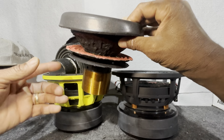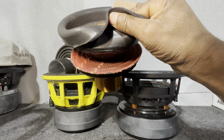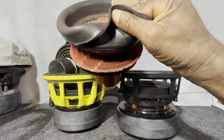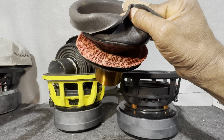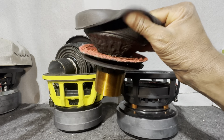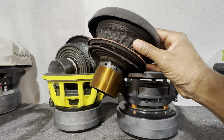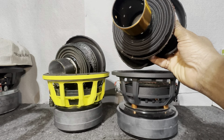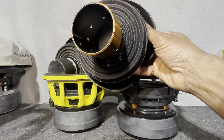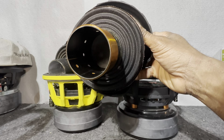The spider, as you can see, is a progressive roll — each roll is getting substantially larger as you go from the triple joint outward. And they have webbing on top of that spider to aid in linearity and more control. Underneath, as you can see, it's a progressive roll spider as well. Look at the ribs — they increase upon the stroke.